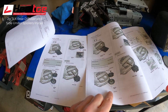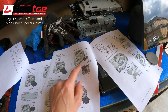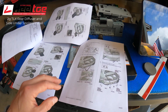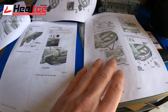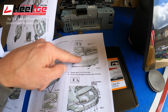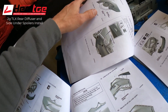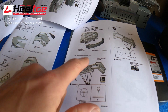You can see the first page is exactly identical for both. We're going to pull out the rear carpet, take the spare out, take out the battery cover, and take out the tool tray. Disconnect the negative battery terminal - between you and me I don't always do that, but that's what the instructions say. They want you to mask off an area around the rear bumper. We've got a retaining tab here, clips, screws - those are going to come out - same in both instructions, then the rear bumper comes off.